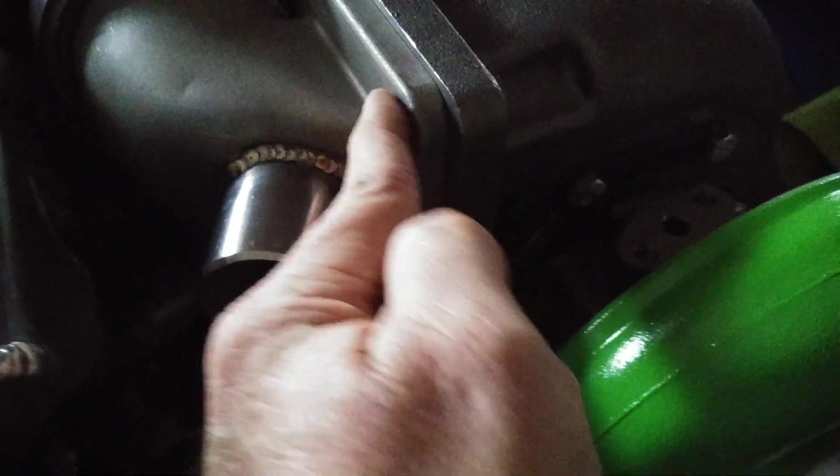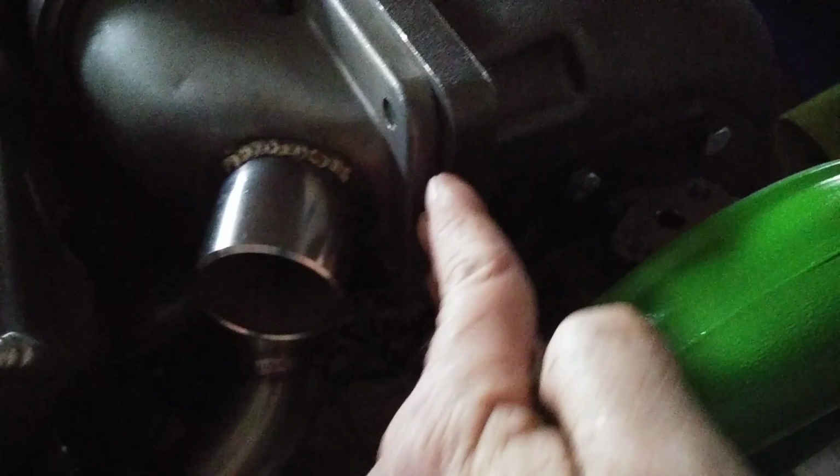And then what I'm going to do is make me a bracket that'll come off of here, around here, out of the 3/16 probably. Then I'll come off of the bracket and bring it around and run it over so I can either bolt it to the head, or there's a bolt hole in the block on either side right here below the deck to add some kind of support to it, or I want something to support it out here. I don't know if I might go off of these two down here and put a little longer bolt in them. They're just a 5/16 bolt. And then come off of here with like a U-shaped or Y-shaped bracket and come over to here.